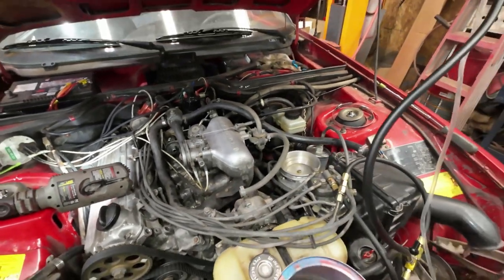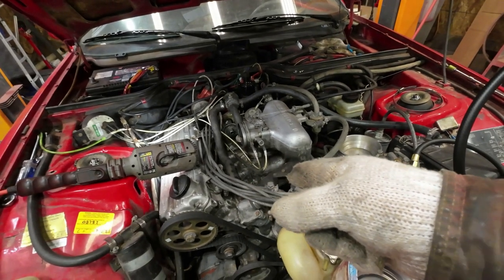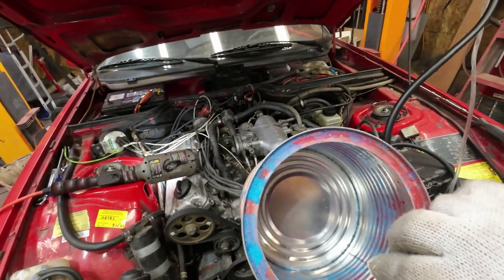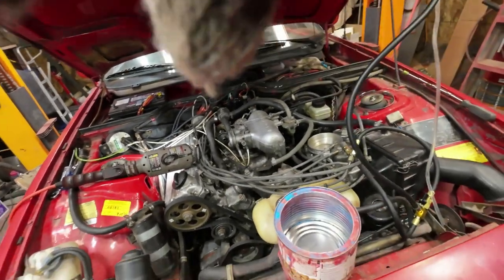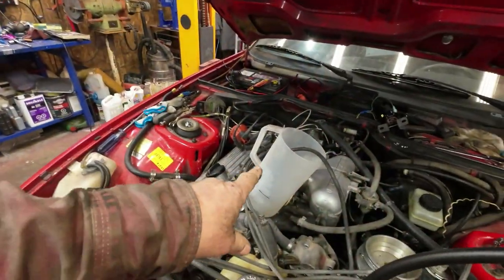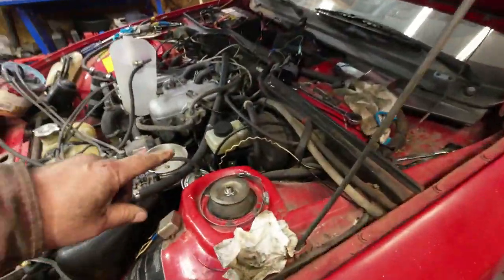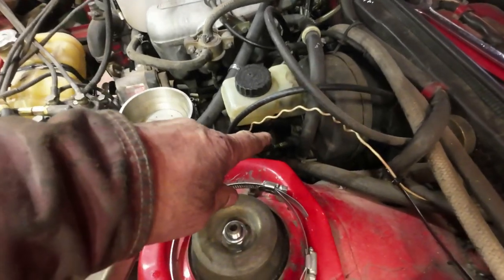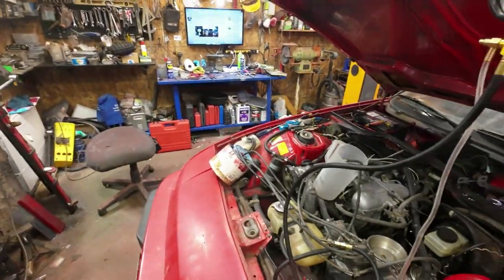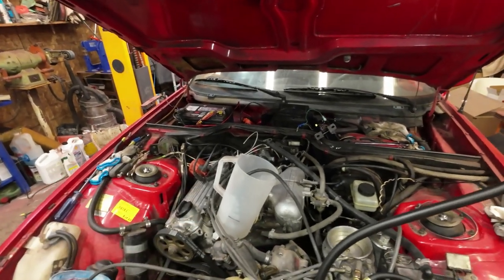First thing I'll do is that, but I'm going to pull the injectors out because I don't want to fill up the cylinders with fuel again when I'm running the injectors, and I'll just put it into here. I better get a clean container, right? Yeah, there, I've got it ready for the flow test. I've got that thing unhooked from down in there. I don't know if you can see that fitting down there, but it's very difficult to get undone because it's made for skinny hands, or for before all this other stuff gets put on there.